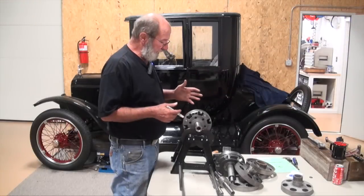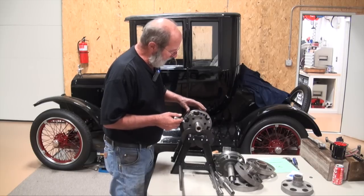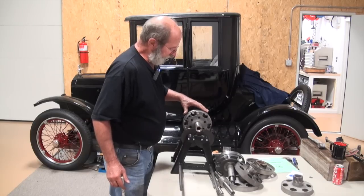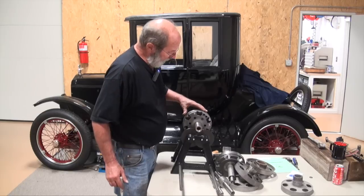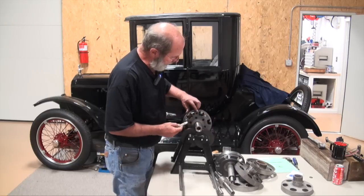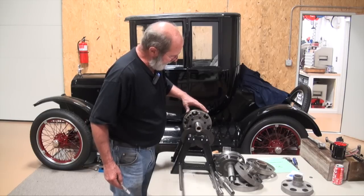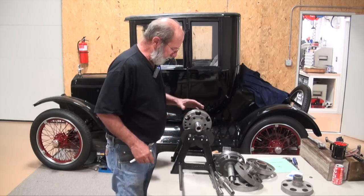After many attempts of drilling and machining out and grinding and removing material, we now have a drum — a drive plate and brake drum — that will stop anywhere I want it to. You can see we took a little bit here, drilled two holes all the way through, did a little grinding with a high-speed grinder here, then we came in here and whittled a little bit off one of the lugs where the clutch discs hold. But we didn't take enough material off to where it causes an issue with the clutch discs.